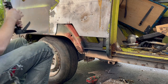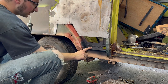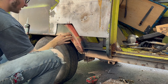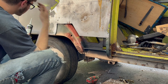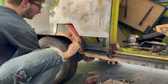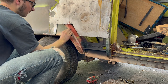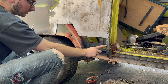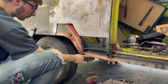All right, guys, so we're just about now ready to do the quarter panel. This part is done, that part's done. This is made. So what we have, so red primer. There's zinc etching primer underneath that primer. The red primer is just so that the seam sealer right here sticks, because you're not supposed to put it on a zinc primer or an etching primer. Now this is zinc here. This is just black something or other. And this is copper weld through.